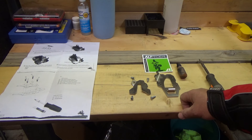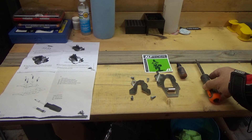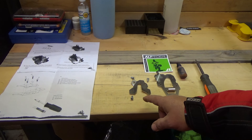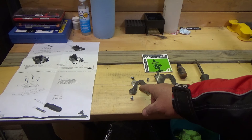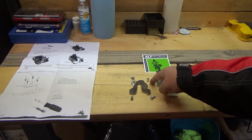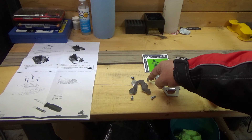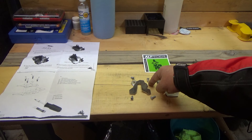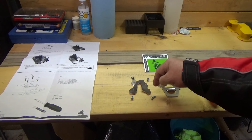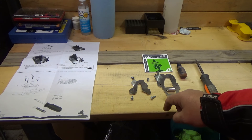It comes with stainless steel bolts. The only tool you're going to need to install it is a T25 Torx. It actually has two M5x12 bolts, and I've laid them out in place where they go because they are different length bolts. We have two of the M5x12s here, then an M5x10 that goes in this location, and an M5x16 that goes in the rear location.